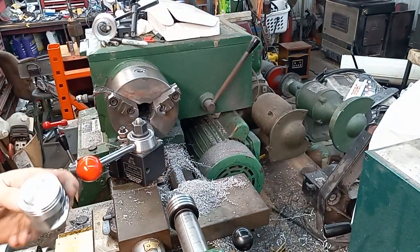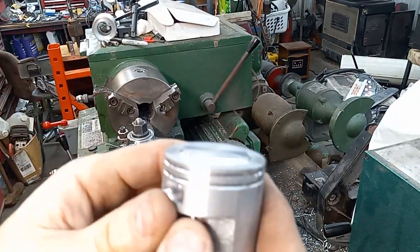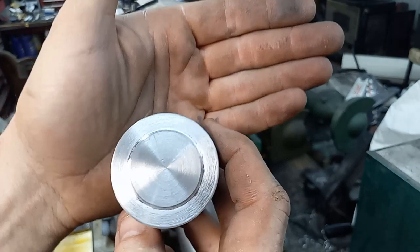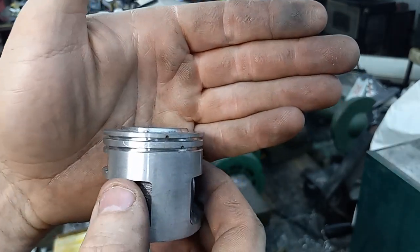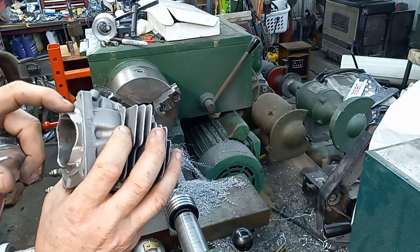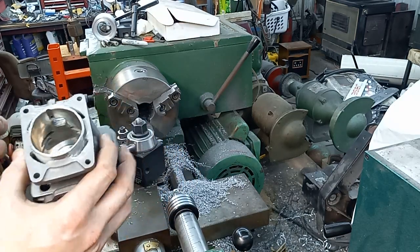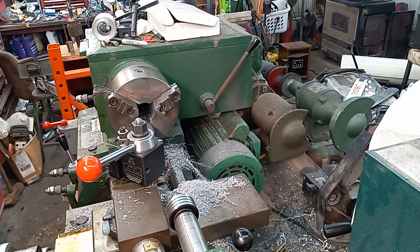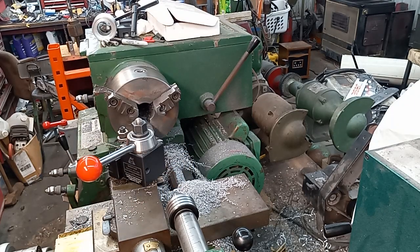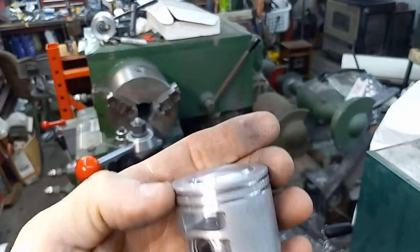Let's see if she'll fit. And she's got a pretty healthy pop-up on it. So that's what we're going to try on this salvage job. He's already started on the lowers — I'm going to accentuate them and I'll have to figure out what the squish is now and get this cut. That'll let me know where my piston sits so I can work on the lowers. But there's a pretty healthy pop-up for a 362.